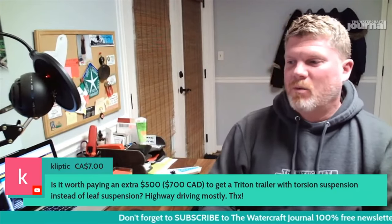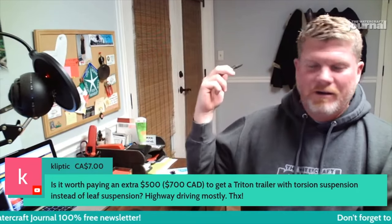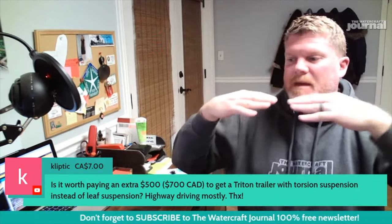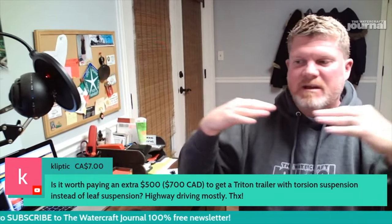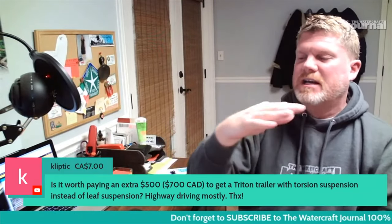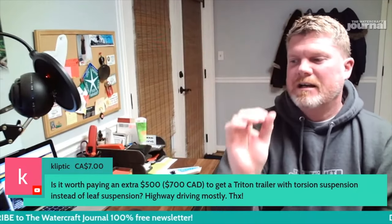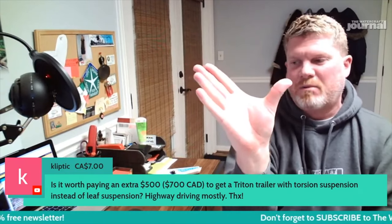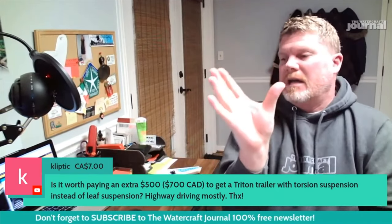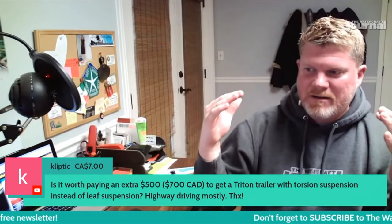When you're driving across the bayous, the Florida panhandle, going into Louisiana — those low bridges over the water are built in sections. Even if they're as flat as an ironing board, you get a harmonic driving over those sections. The leaf spring will bind and extend, bind and extend. Energy moves through the leaf spring, and when it releases, the trailer bucks up. You hit another dip, it binds again, bounces up — it never equalizes, so the trailer is bouncing your brains out the whole way down the road.